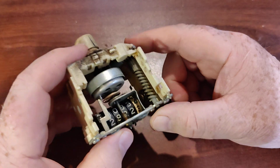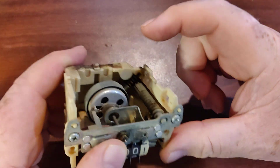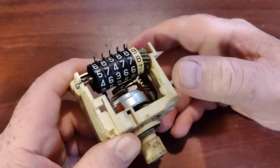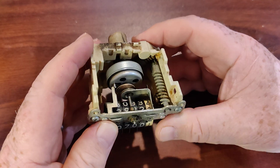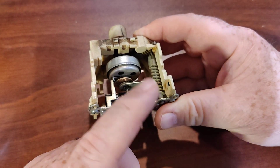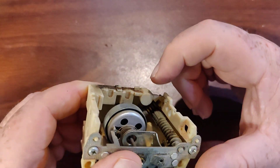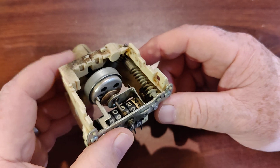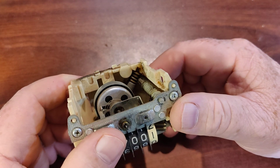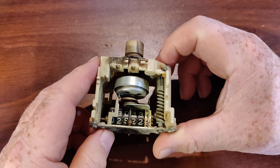The odometers will burn out because there's a couple gears back here. There's a gear turning off of the main shaft that feeds a gear here, that feeds a gear down here, that feeds another gear. If your odometer is stuck and these gears are binding against each other constantly, they'll eventually wear themselves out. The little teeth, especially in this back section, will get worn out. So if you're spinning it with a drill and this gear here isn't turning, there's a good chance that section is worn out — and it's not really removable back there, so you'll be searching for a new body housing. But by and large, these newer ones typically don't go bad.